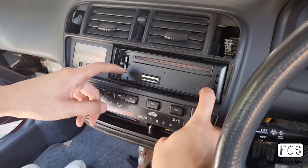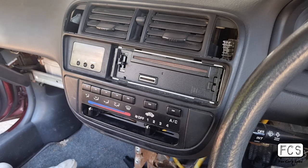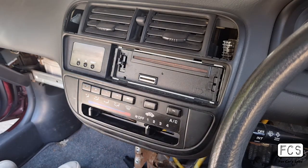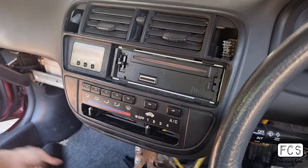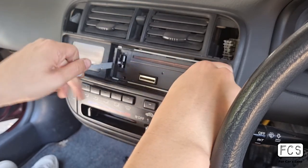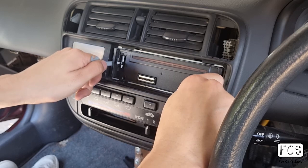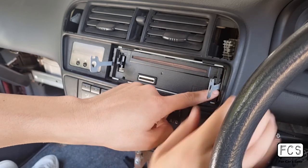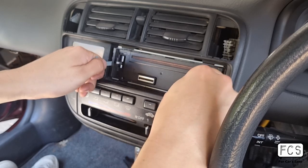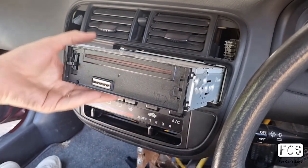Okay. With the Kenwood ones, you'll find four little spots. If you just push your finger down, that's basically the easiest way I found to take that out. And let me just grab the two keys, stick them in right in the middle after you've got it in. Push downwards or upwards, so this little tooth will hook on to this, and obviously maintain pressure towards the middle while pulling, and it should just come out like this, nice and easy.